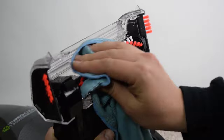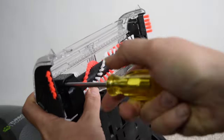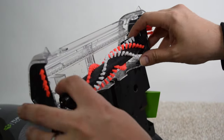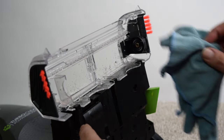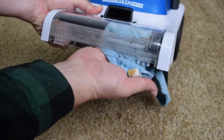That being said, I did prefer the Bissell over the Hoover for a few reasons. As I mentioned in the Hoover review, cleaning carpet cleaners after each use is pretty important, and cleaning the Bissell was quite a bit easier than the Hoover. For example, instead of removing multiple screws to clean the brush and top portion of the plastic cover as with the Hoover, there was only one screw with the Bissell. And though you still have to remove the belt, it was much easier to do with the Bissell. Also, the removable piece was easy to rinse out, and all the major places that needed to be cleaned could be easily accessed, unlike with the Hoover.